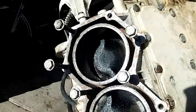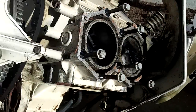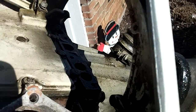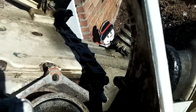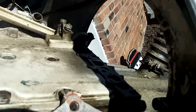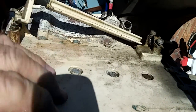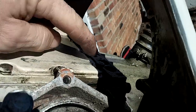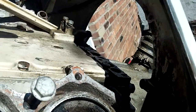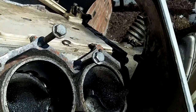The water jackets look clean. I did have a little water leak — water was pooling up behind the thermostat, so I pulled it off. The gasket looks in good shape. I can see a quarter-20 bolt right there that has backed out. I don't know if this has any cooling effects or if it's just a cover for the crankcase, but all these bolts were loose. This one was backed out quite a bit.